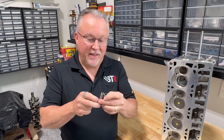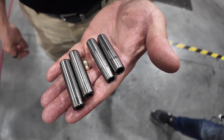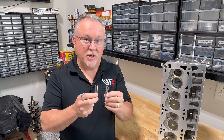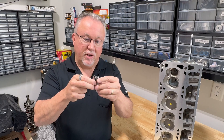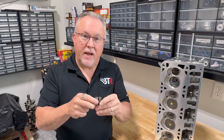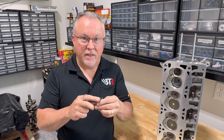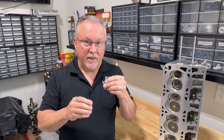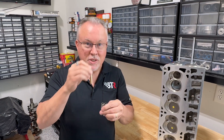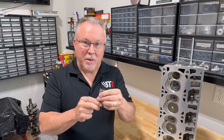What I have in my hand here today is the new BTR powder metal valve guides — something that took us about two to three years to bring to fruition. We have Gen 3, Gen 4 length, and then the longer Gen 5 length. These guides have the absolute best powder metallurgy that money can buy — this is a no-holds-barred best powder metal guide made. If you have an LS or LT head from GM and you're going to use stock rockers, please don't put bronze guides in it. Contact BTR and get the powder metal guides.